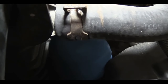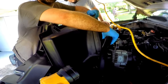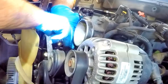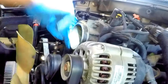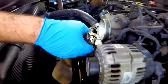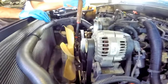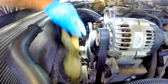Just lift the center pin and the rivet will come right out. Unclip any hoses and hold them out of the way as you pull the shroud out. We're going to use a C-clamp with a rubber boot that makes contact with the top of the belt and clamps to the water pump pulley, preventing it from turning while loosening the fan. Use an adjustable wrench to loosen the fan bolt and then spin the fan off by hand the rest of the way. Using a pipe with the adjustable wrench makes it a lot easier.